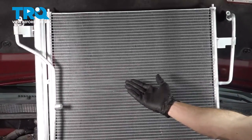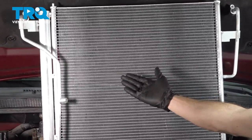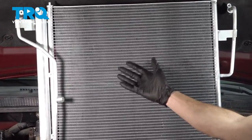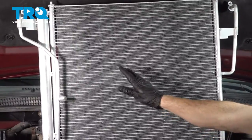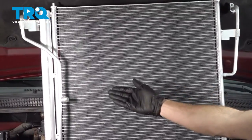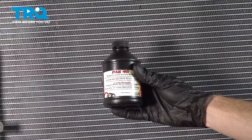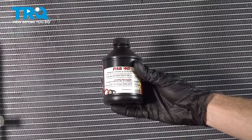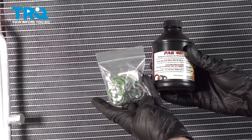In this video we are going to show you how to replace your AC condenser. Before we start taking anything apart, make sure you're wearing hand and eye protection at all times, and have a professional safely evacuate all the refrigerant in your system. You're also going to want some PAG oil — it's special AC oil — and an assortment of O-rings for the AC system.